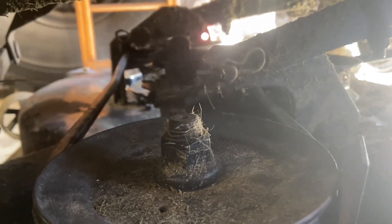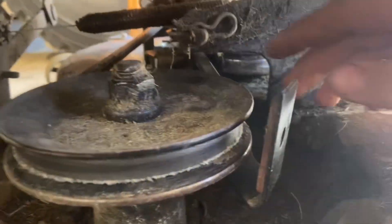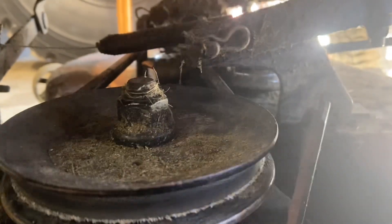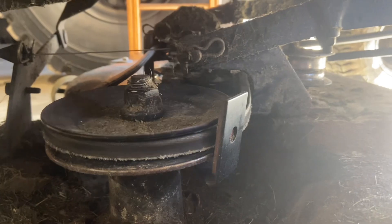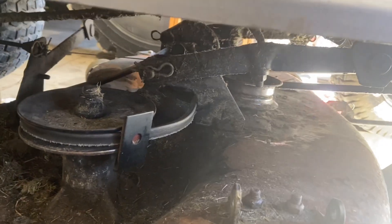I'm going to put my phone down and do this — just pop it right around this pulley here. I was able to get that back around. Now watch what happens whenever I engage it. See that? This is a lot better. Whenever I disengage it, it doesn't really snap forward like it's supposed to, so I'm pretty sure the belt is pretty worn out. I'm going to get another belt, put it on here, and this should be ready to go.